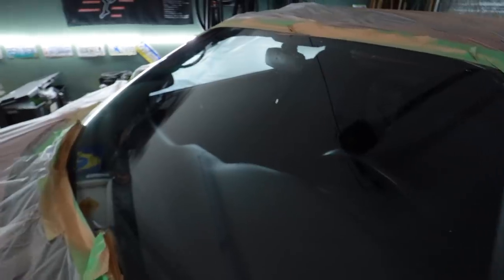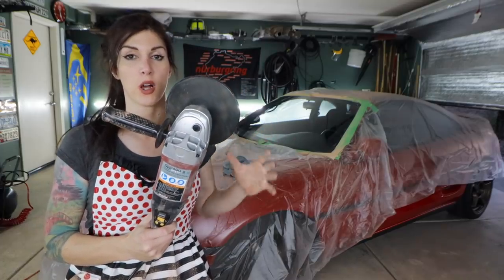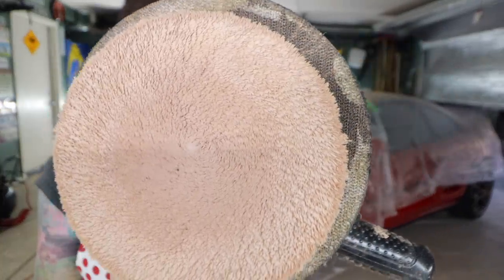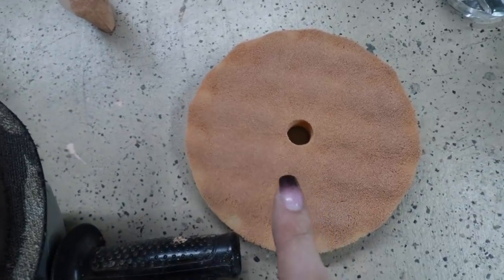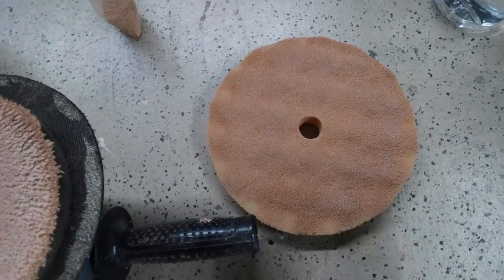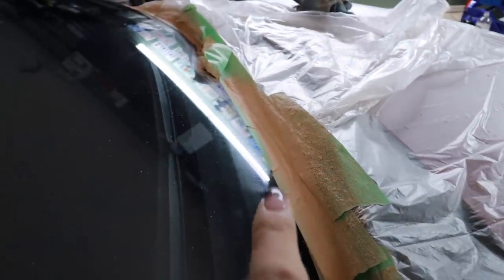I had to do a special little trick to get it to work. The scratches are gone. What I was using was a foam pad on the rotary and it was not working, so I put a cotton pad on there — it doesn't quite fit because I don't have the right diameter for this rotary. The difference between felt and cotton: the reason you're supposed to use felt is that the foam pad has a bunch of holes in it, so it doesn't hold the liquid — it just slings it out all over the place. Whereas cotton retains moisture and allows it to create a paste and sit on the windshield for a longer duration. I have one last thing — the very edge of the windshield still has scratches, so I need something small to get into that area. Luckily I have a tiny cotton one that goes on my air compressor tool.